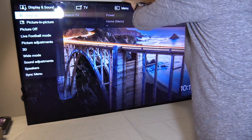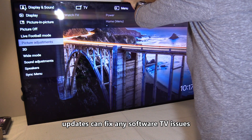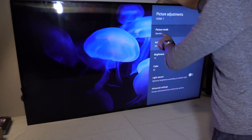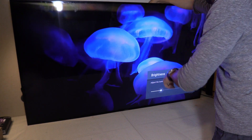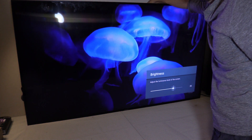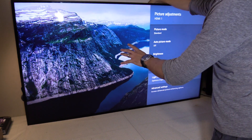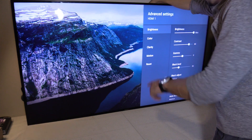Nothing too crazy, right? Let's go to settings. It is recommended to update the main logic board, so if you fix the TV always update the main logic board using the Wi-Fi internet settings and set it to auto update. I have it set to standard. I have auto picture mode off and the brightness lowered to 15, but let's raise it and see if the temperature rises. I also have the light sensor turned off — that's just ambient light detection that makes the picture bright and dark depending on room lighting.